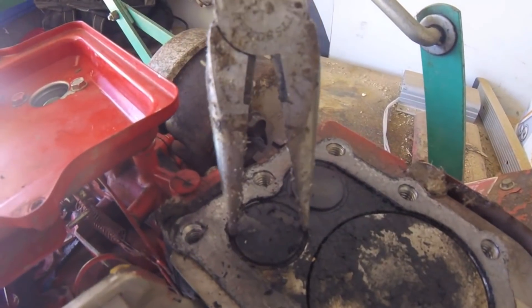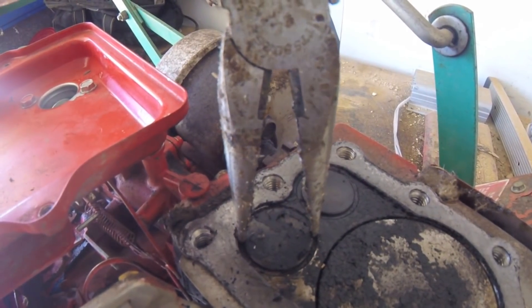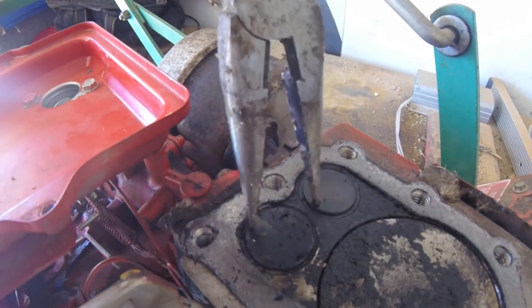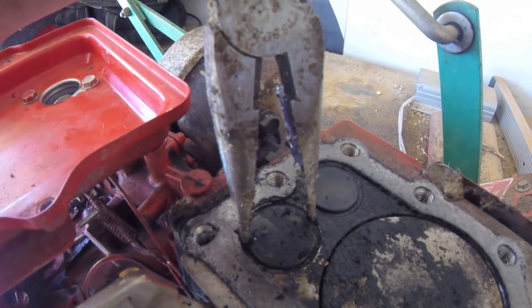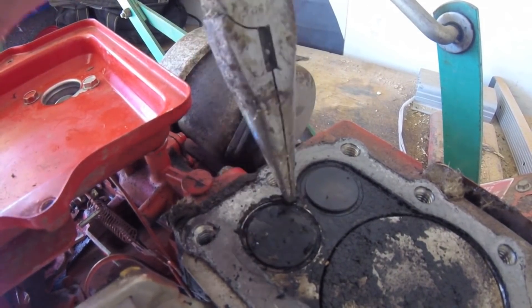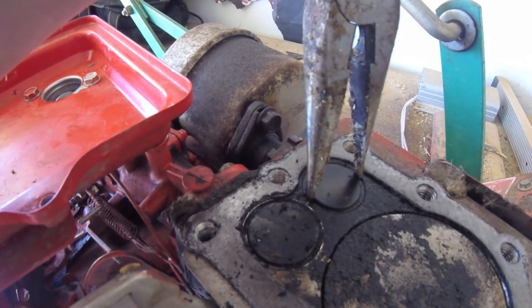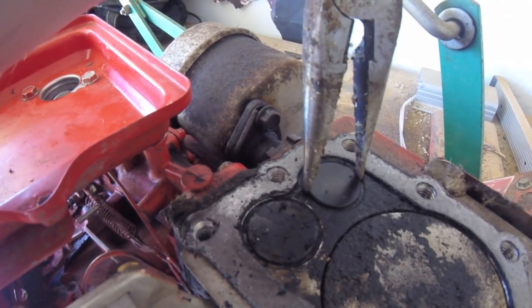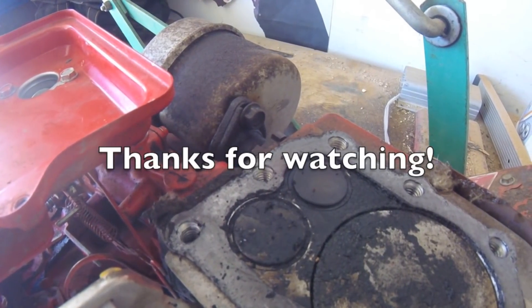See how loose it is? It's pretty loose. I would say that intake valve is not seating. At top dead center compression stroke you should have full spring pressure on this valve, and it does not seat very well. I might have to pull this apart. I'm gonna see if I can sneak in there and clean that carbon off. But this one's looser than a two-dollar whore on nickel night. I'm probably gonna have to pull these valves and grind the stems to get a little more compression in this thing before it'll run.